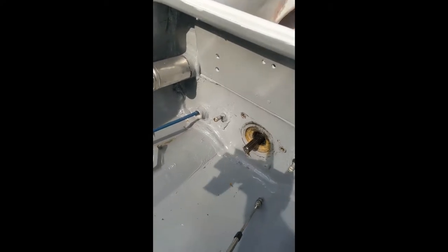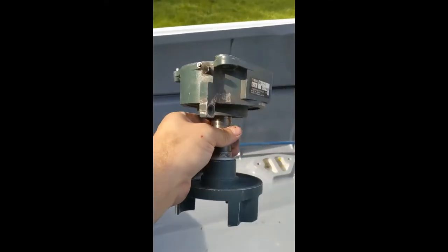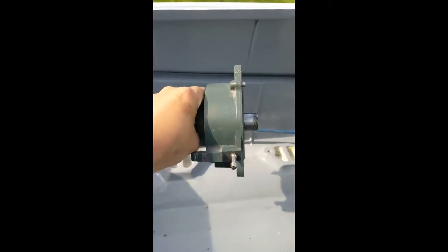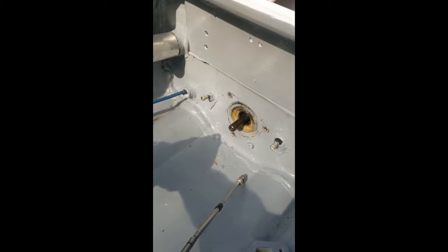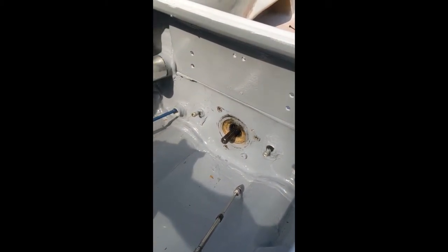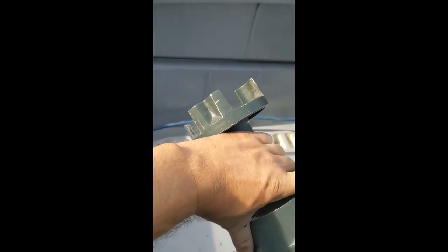If you don't have this shaft centered, when you put your mid shaft on, it's going to be pushing down on this housing here, which will cause unnecessary heat. And if it's pushing really hard down, a lot of people burn through their mid shafts. So make sure that's centered first with shimming it from the back, and then put this on and make sure it's centered with your engine. And that's when you use shims on your engine mounts so that it lines up with the mid shaft.